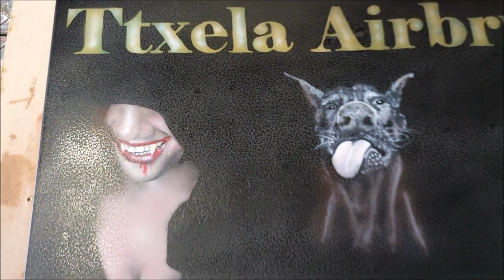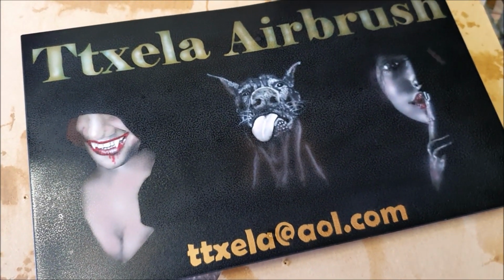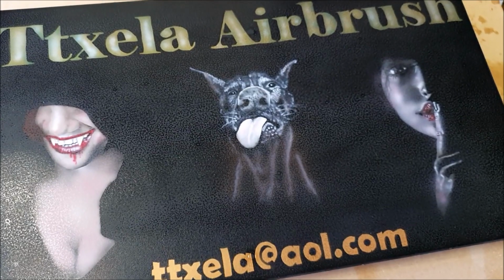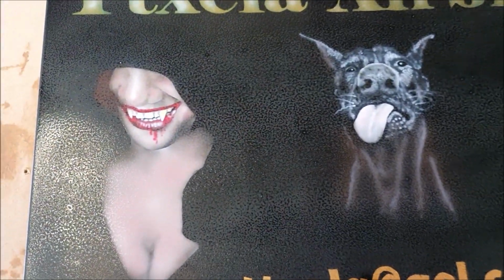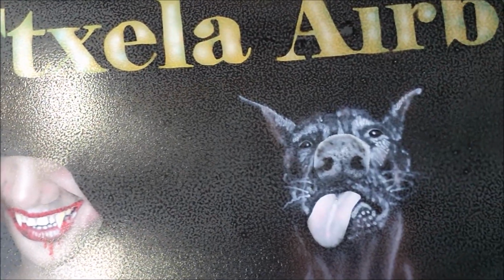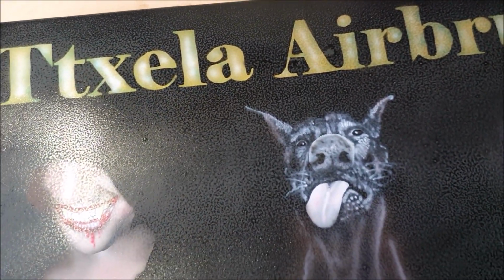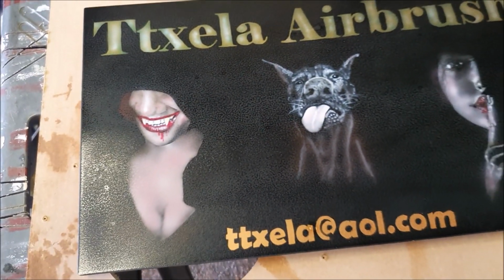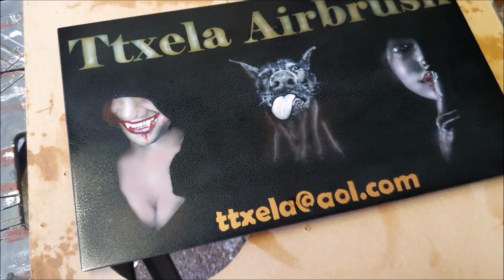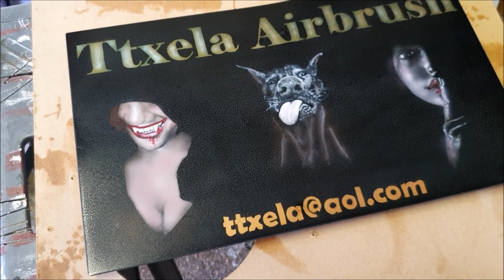But because this is supposed to be a display piece of really the best I can do at the moment, not that I'm saying that's wonderful or spectacular or anything, but I want to do the best I can on this piece, I am going to try the old flow coat. So I'm going to give it another coat of clear coat, a heavy coat of clear coat. I'm going to whack the pressure up so that the clear coat atomizes better.